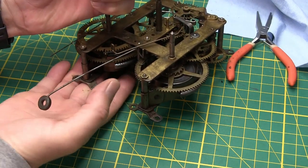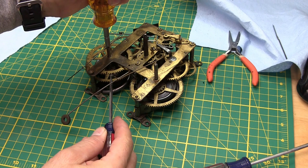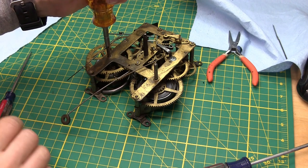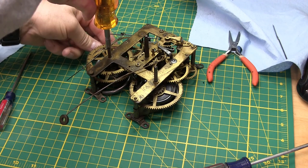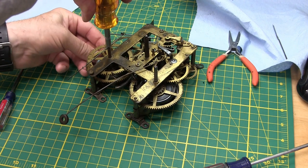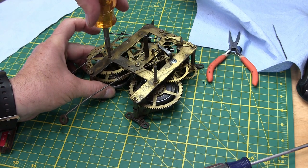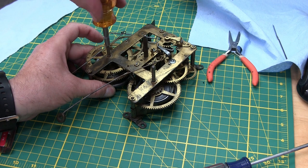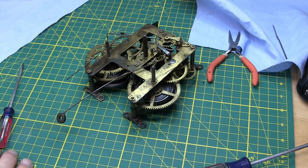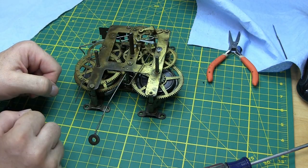Sometimes the springs on one side or the other are different lengths, so it's good to keep those separate. Push the spring off of that retaining clip — I actually like the way they do that. Kudos for Japanese design so far. I'm going to keep this clip up halfway as it expands. There we go — there's two mainsprings with the retaining clamps on. The power is considered taken off; no power force is being applied to any of the gears now, and the movement plate and everything can be safely removed.